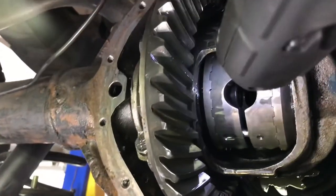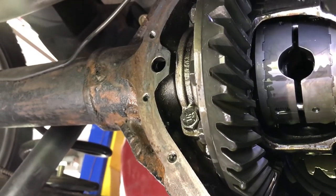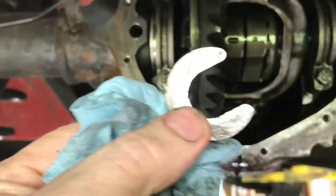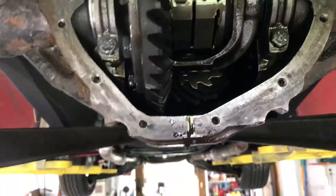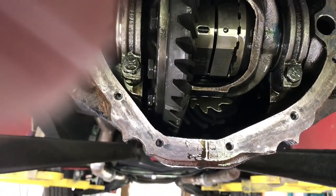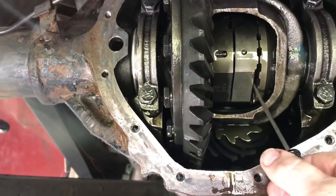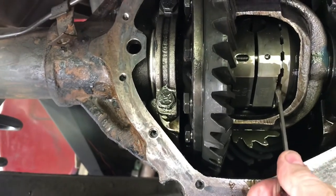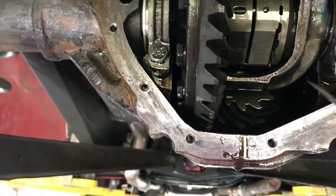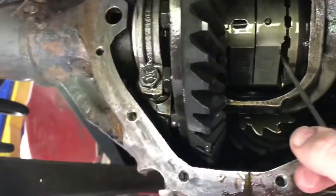These axles have a clip — you push the axle in, get the clip off, then pull the axle out and that should let the gear come out. Got the clips off the ends of the axles. The easiest way — after fishing the driver's side out from the inside — if you turn this down there's a wide slot. You've got to get the clip in the right direction where it can fall out, but if you pry out on that, the clip will fall right out of that slot. Got them out, got the axles loose.